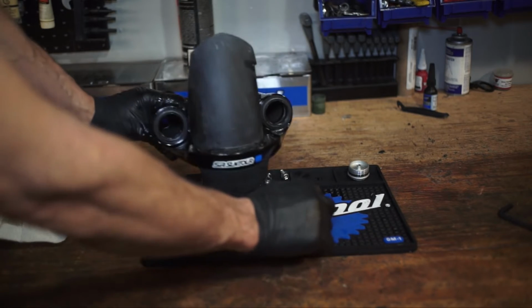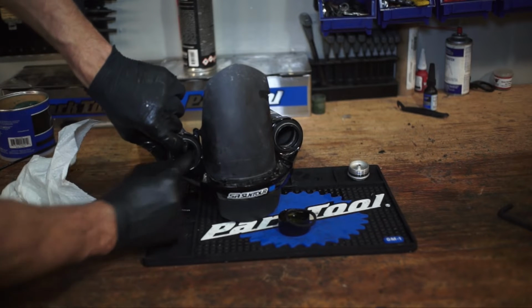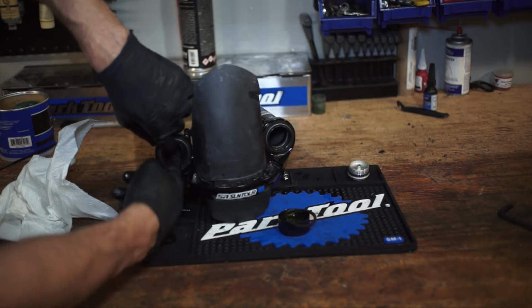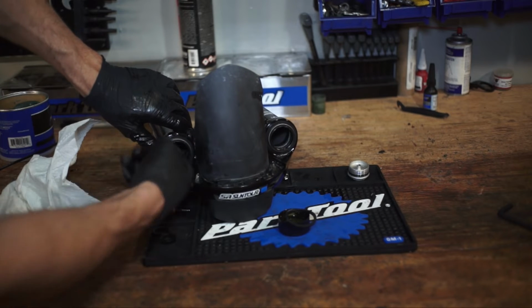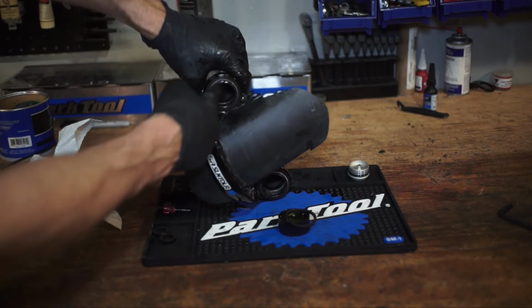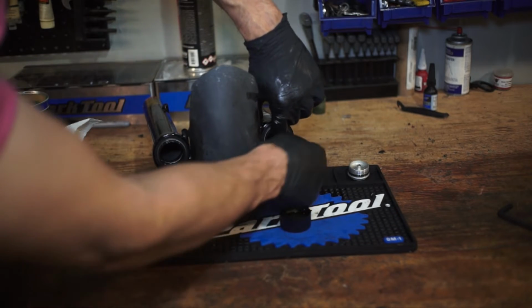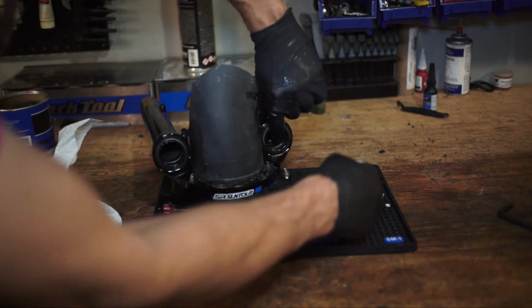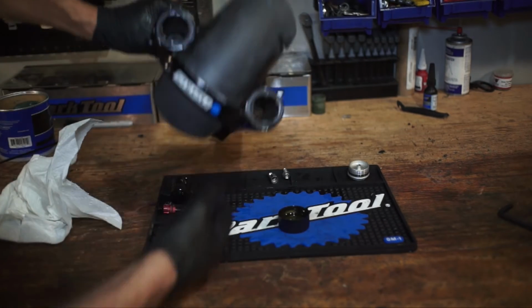we're going to go ahead, separate our oil seals, and just tuck it in underneath the new seal. There we go. It's all the way inserted and fully around. We don't want this to get out of place or out of shape so that it will bind up and cause any problem when we're sliding the forks back on.